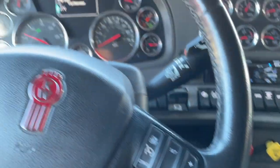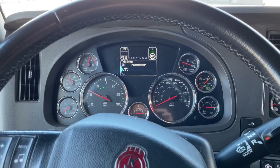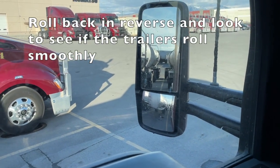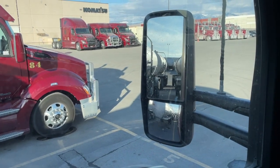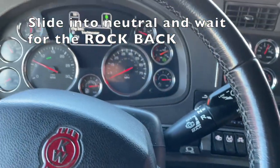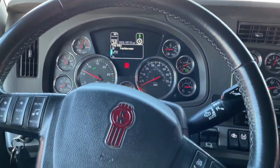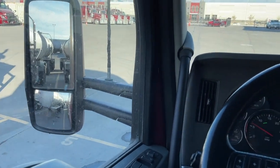Before you go, there is one last step to making sure your trailer is okay to move. I've just released my truck air and I'm going to put it in reverse — we want to make sure there isn't a brake that happens to be locked up, which usually happens from rust. I'm going to slightly roll backwards and watch. I'm not seeing anything binding up, which is a really good sign. Then I kick it into neutral and let the truck roll — you see that it rocks back in neutral. If I had a brake locked up, it just would have stopped. Because it rolled and rocked back, I know they're all good to go. This trailer is ready to rock and roll — let's go get a load.